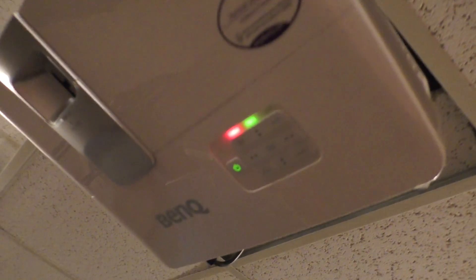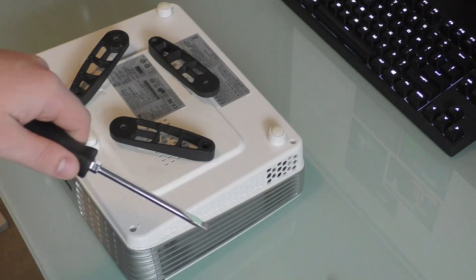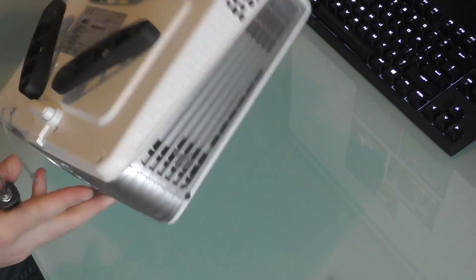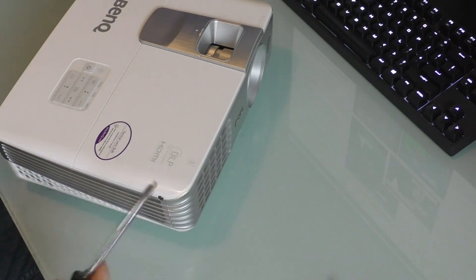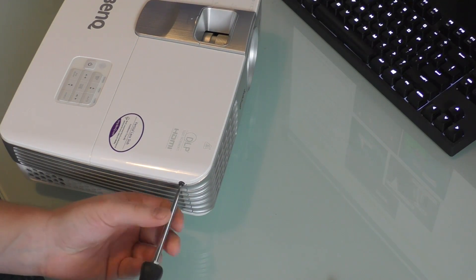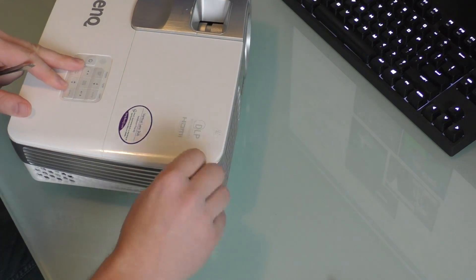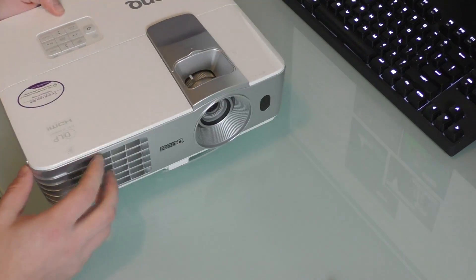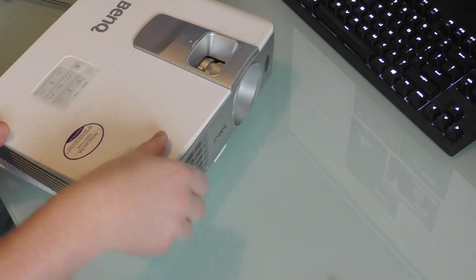What I had to do was take apart the whole projector. There are four fans inside, and what had happened is that the glass exploded and got sucked into the blower fan, which is in the center of the projector. That stopped the blower fan from circulating and blowing air onto the bulb, thus making the projector overheat.